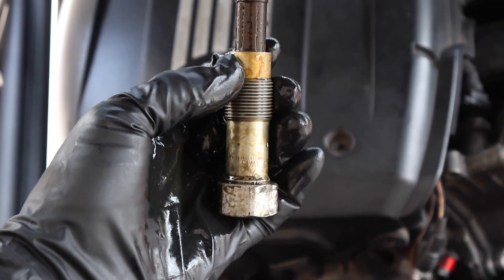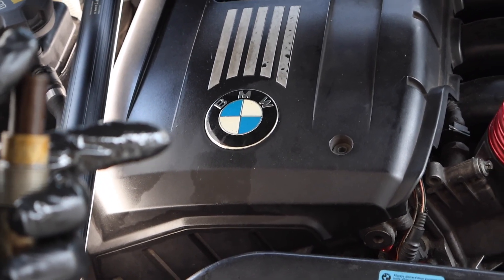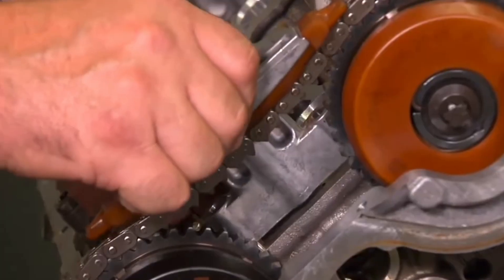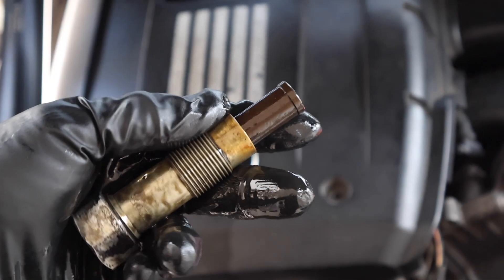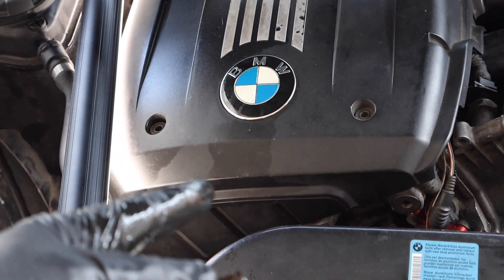This is extremely dangerous for the engine: if the piston is not providing ample pressure against the timing chain guides, the timing chain operates loosely — which explains why my vehicle has had a good amount of timing chain slap in the last couple of months. Replacing this with a brand new one should tighten everything up and make my engine operate much more quietly.